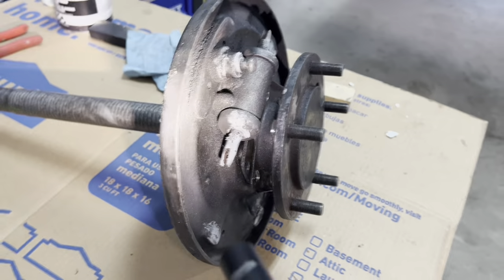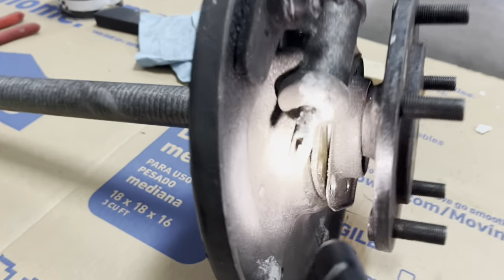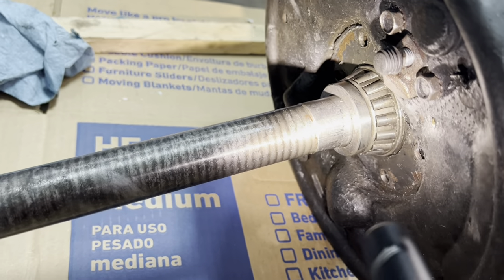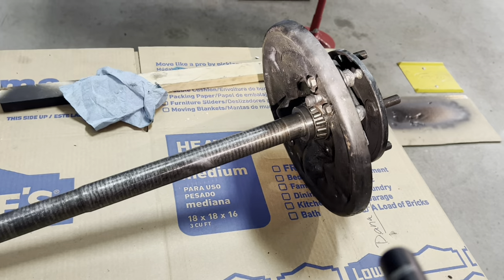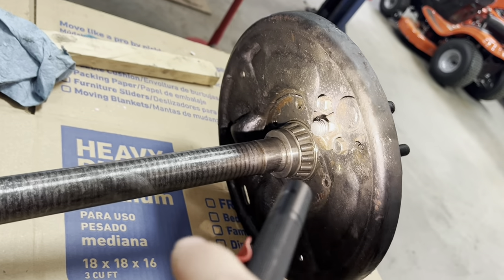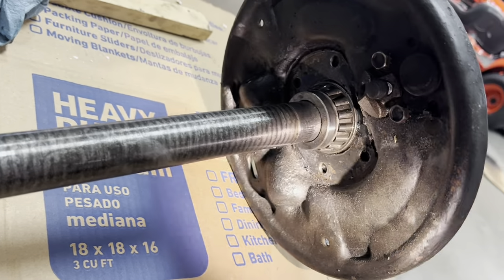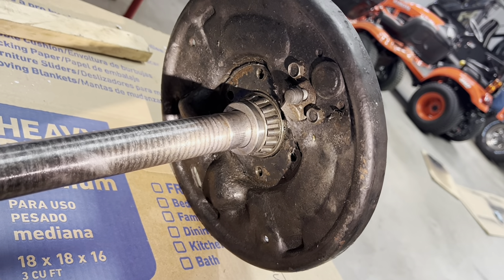Here's the one-piece shaft — here's the drum brake, the backing plate, the wheel cylinder, and the outer end with your lug nut studs. Looking inside, there's an outer oil seal pressed in. On this side you have your bearing, then the spacer or bearing retainer. All of that has to be pushed in with a pretty good-sized press — your home press may not be powerful enough if you just have the Harbor Freight job. You can't sneak the wheel cylinder out through the back, so this whole assembly has to come out if you need to remove the axle shaft — you have to disconnect your brakes. There are supposedly modifications people have made to the plate so you can remove the shaft without taking the plate out, but as far as I know, that's not possible.